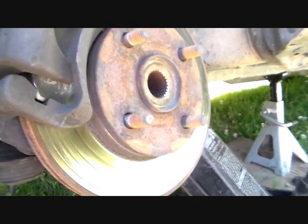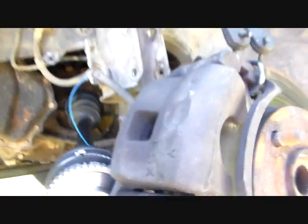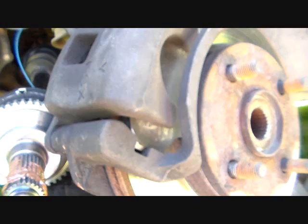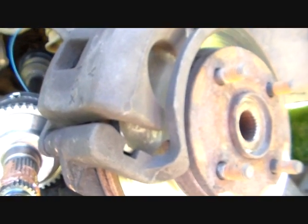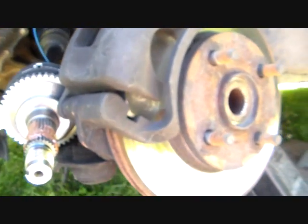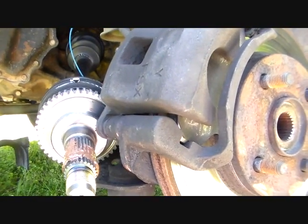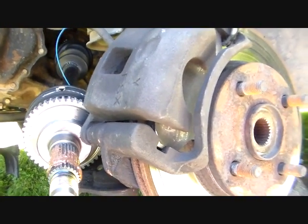And plus, if you go back to the video that I made about three or four years ago, whenever it was, where I won the Idiot of the Year award, it's because I put a red Mazda I had back then back together after doing a wheel bearing and didn't tighten the lugs up far enough. And they make a distinct sound when that happens. You step on the gas and they go blah, blah, blah, blah.